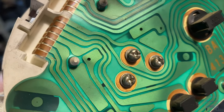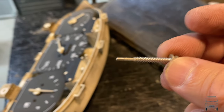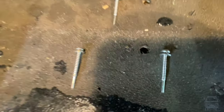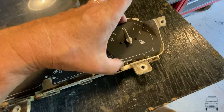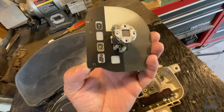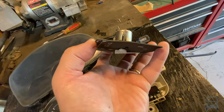Keep in mind that these screws are also the contacts, so you don't want to lose them or use something else — these guys need to go right back there. This is the first screw, so yeah, you don't want to lose these — you're never going to find them again. I stacked them in order. They all look to be exactly the same but they're super proprietary-looking screws. In theory, this should just come straight up and out. I'm going to do what I can to try and clean this little fella up. It kind of looks like a sealed unit, so this might be a lost cause.